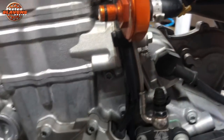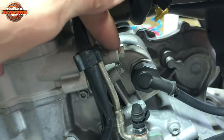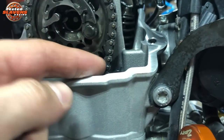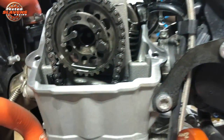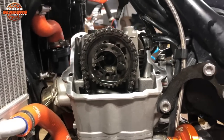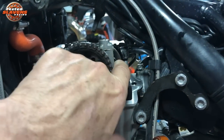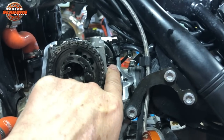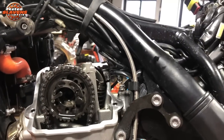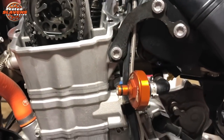The stock cam chain tensioner, which is kind of buried in here — it's this piece right there — keeps tension on the cam chain by pushing on this pad right here. I'm really tired of this thing having a ticking sound. It's not a real loud sound, but it's tick tick tick once the motor is really warmed up. It sounds like your valves need adjusted, which would be this adjustment right here where my finger is, but the valve adjustment on this bike is totally within spec and the thing still has that noise. It's kind of annoying, so I'm going to change it out to this Tokyo Mods cam chain tensioner, and that should get rid of the noise.